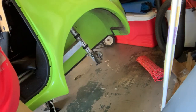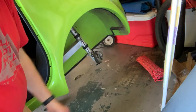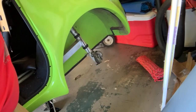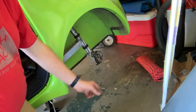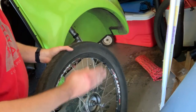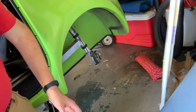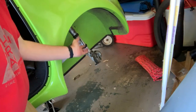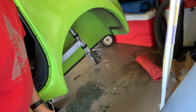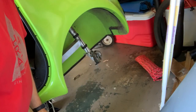This is basically the way this thing functions — when you squeeze it, it presses these pads up against the outside of the housing. As this thing wears down, the pad will eventually need to be replaced — that's how those work. Because there's so much mass in here, it takes a lot to heat them up — unlike a disc, which is a thin piece of metal. That overheating is what causes your brakes to fail. With a cable system, the cable doesn't really care if it gets hot, and generally speaking, these pads won't care either. I'd just recommend avoiding steep 20% downgrades at speed.